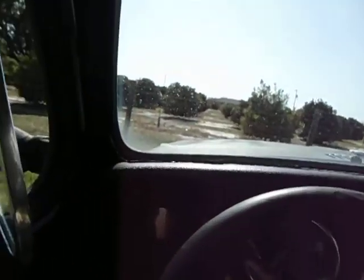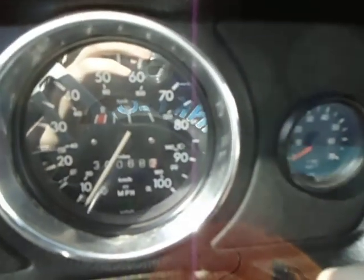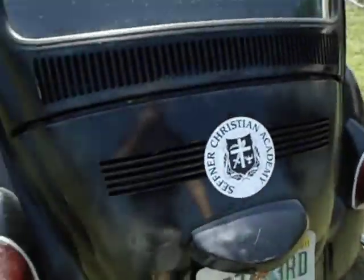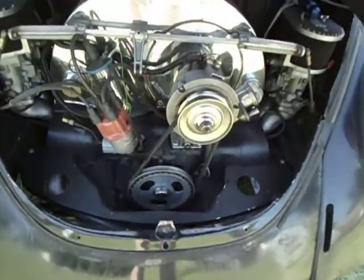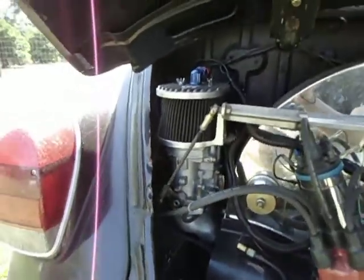Brakes don't like working. We need to bleed them and put more fluid in. And that's pretty much all. It runs good. But these carburetors have a weird fuel pressure. Very sensitive. We had to change out fuel pumps several times because they never liked running right. We finally found one that works good. It takes about 3 pounds of pressure for the fuel in these carburetors.